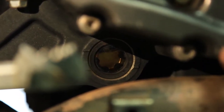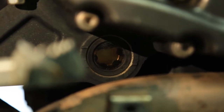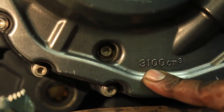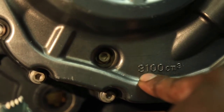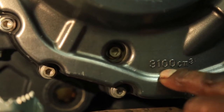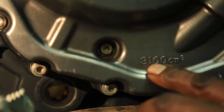So like this one, you can see the inspection glass — our oil level is on the right spot. The bike manual says 3.1 liters, which is also stamped on the side of the bike. But with changing the oil filter as well, it will take 3.8 liters. So that's how you do an oil and oil filter change on a bike. Thanks.